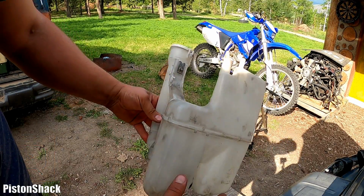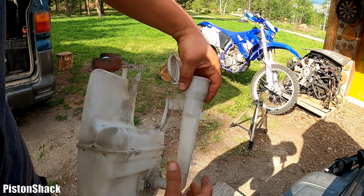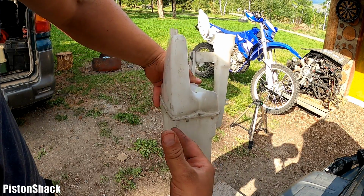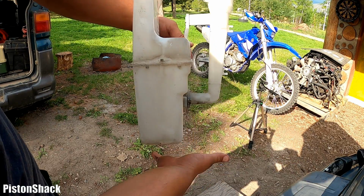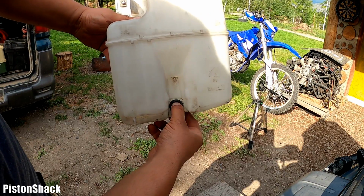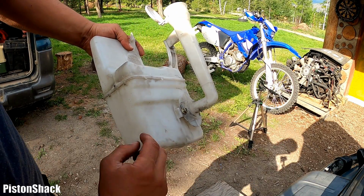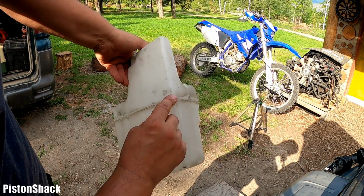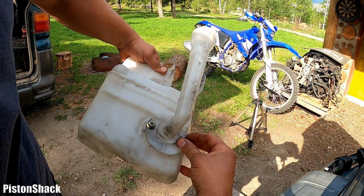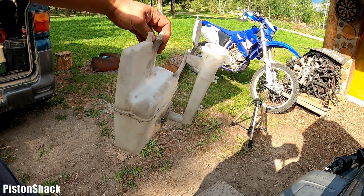While waiting for a leak to show up, let me show you what the windshield washer reservoir looks like on the Delica. This is the filler cap. Here's the neck, which is under the hood. This part attaches to the tank itself, and this bottle is behind the fender inside. You have a wheel well cover on the bottom here, and the pump sits behind. Here's a rubber grommet, and yeah, quite a few places where it can technically start leaking. It can have a crack around the edge where it was glued, upper and lower parts of the tank, a leak from the grommet where the neck attaches, which just bolts through the fender like that, or a leak from the grommet where the pump is. Don't know. We'll find it out. But this is how it looks.